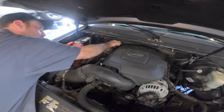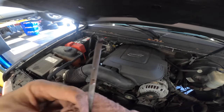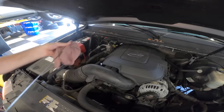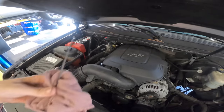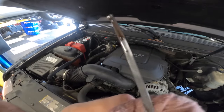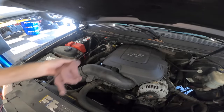Time to re-pop the hood. Let's see what kind of condition our fluid's in. Terrible. It's dark in color. Let's do one more dip - and it is also low, maybe about a quart or so low.